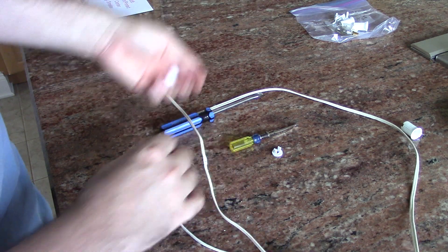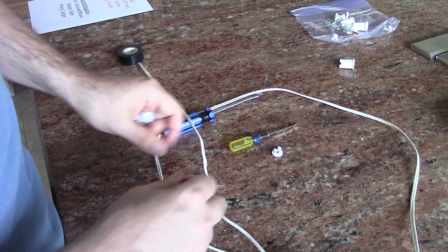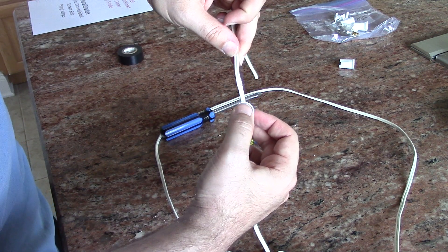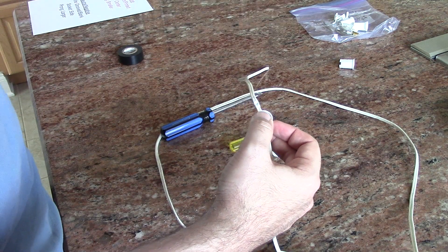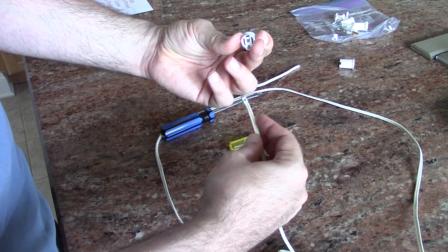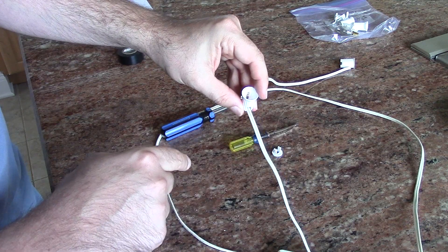The old socket takes up maybe an inch of wire. I want to get as close as possible to where it was, so I'll move it down to about here. I'm also going to wrap this with electrical tape — even though no water gets inside the north pole, it's always good to cover bare wire. I'll get this wire positioned with the neutral-side prong facing the neutral wire, put it a little bit further down, then get it on.